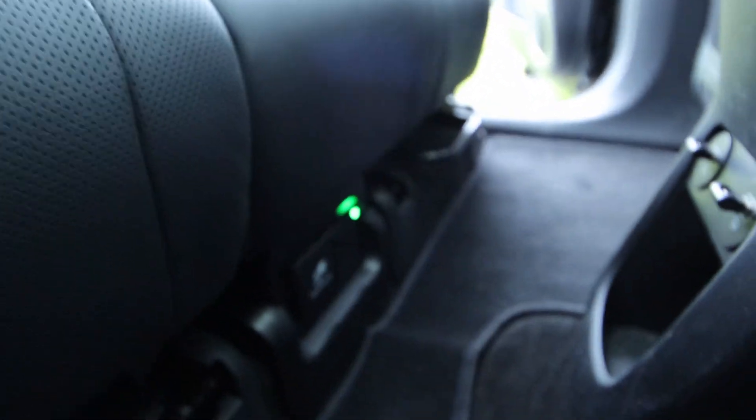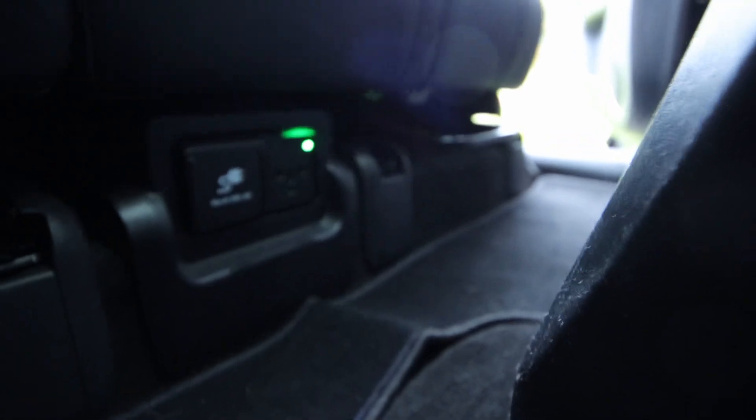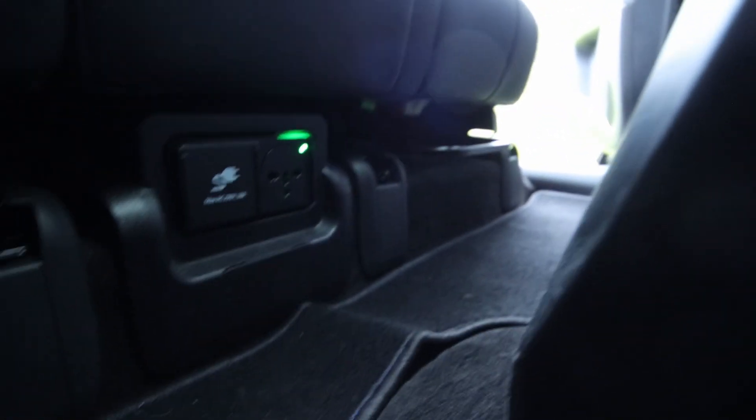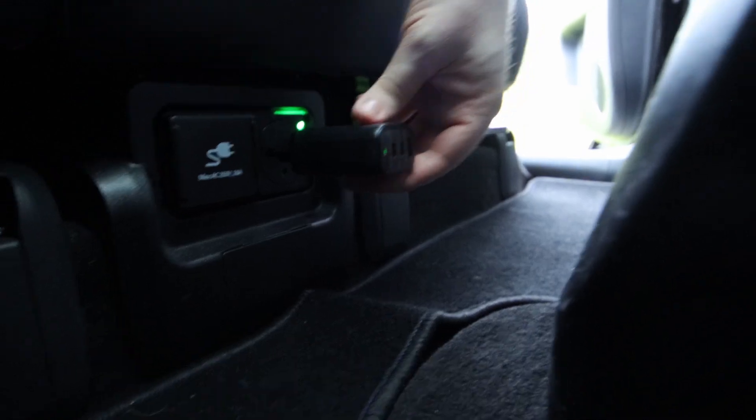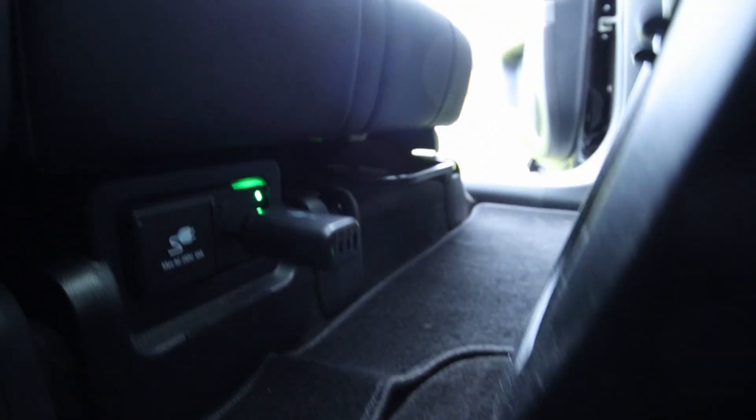If you have a hotspot on your phone, you're going to run out of power quickly — and you're right, I will. But down here between the passenger seats, there is another 220-volt outlet. So I can just take a charging brick, plug that in there, and with a few USB cables I can now power everything inside the car, because that outlet runs on the same vehicle-to-load system as the port outside.